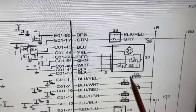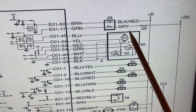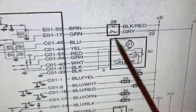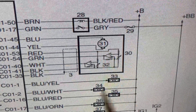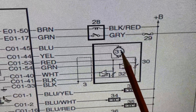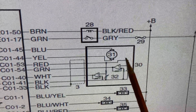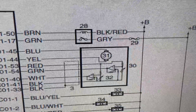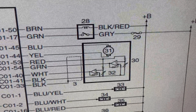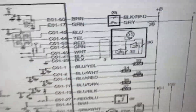That relay is item 28 on the drawing, but we'll keep it basic and focus on item 31 — the motor coming from the drive circuit. The electronic throttle body consists of the motor, which drives the throttle plate via a gear train, and is spring-biased in both the opened and closed positions, with two-channel sensing for throttle plate position for control purposes.